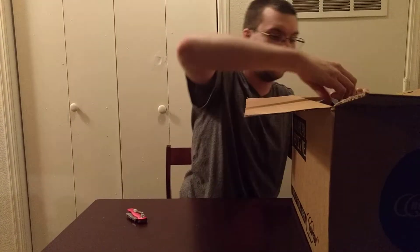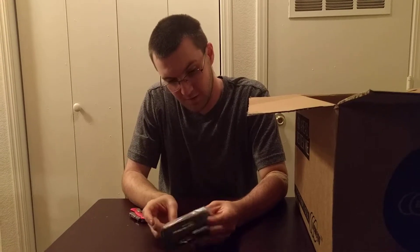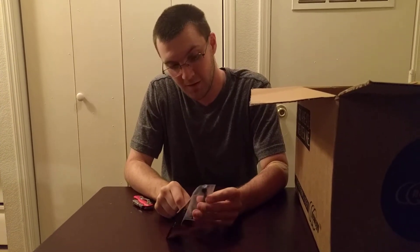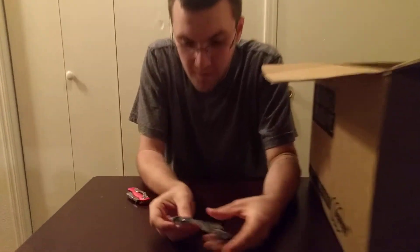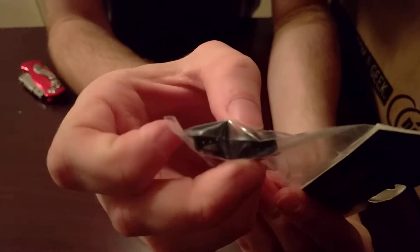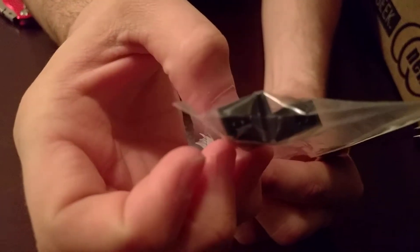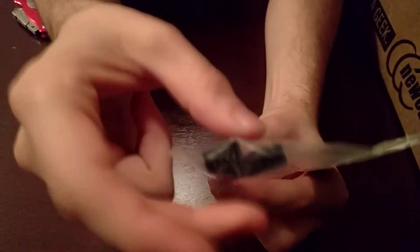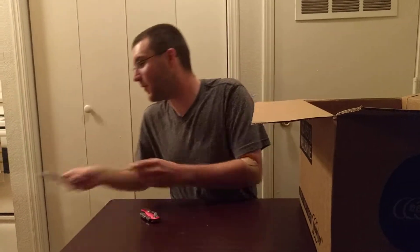Let's go for the small thing next. Got a little fan splitter from Phanteks here. It takes a three or four pin fan and puts two of them, and then the motherboard sees both of them as one. A lot of people actually look at this online and notice that one of the plugs is missing — that is actually the way it is supposed to be, because that missing one is what sends to the motherboard the fan speed. The motherboard doesn't need two fan speeds coming to it, so it is intentional that it is missing. It's funny reading reviews of people that don't understand a product and say it's missing something — no, that's exactly the way it should be.